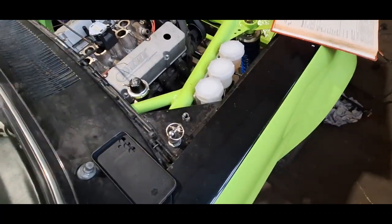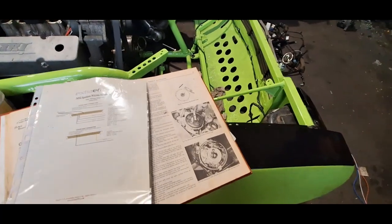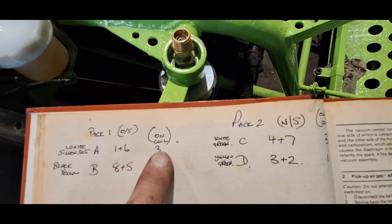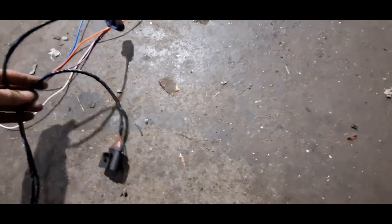I've got that noted down. This comes from the diagram on the Extra EFI website. Here are my Spark A, B, C, and D outputs. Obviously if you have a four-cylinder you'd only have A and B, but for an eight-cylinder that is my firing order — that's a Rover firing order, I believe it's also a Chevy firing order; you'd have to check for Fords and Mopars. Spark A is cylinders one and six, going to position three on the coil on the driver's off side in the UK. So I've made a little loom up — these are the feed wires to the coils, one to each coil, with the slightly longer one going to the coil further away. That goes to a loom plug — some waterproof plugs I had — and that will go under the bulkhead so I can remove that section without any issues.